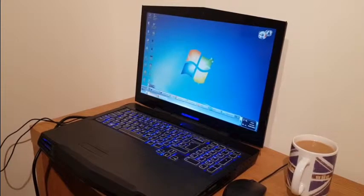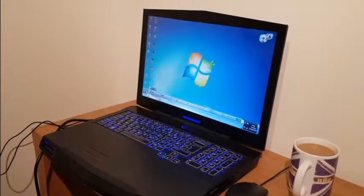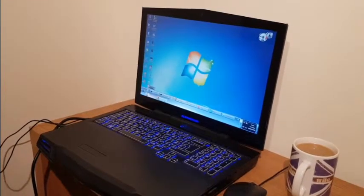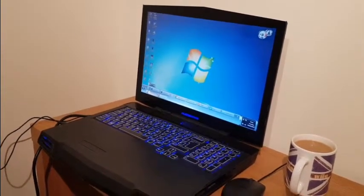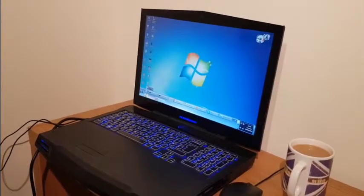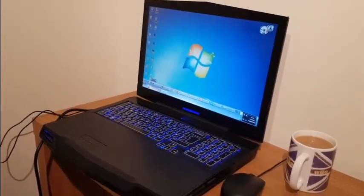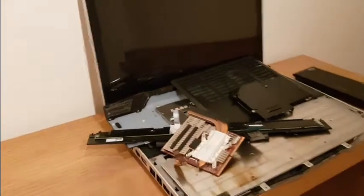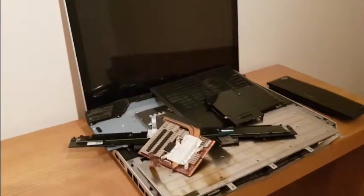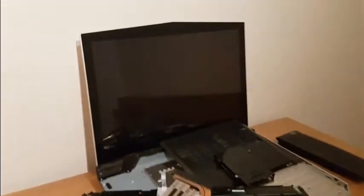At the moment when I am just plugging it in, it's not switching on — it's actually not even lighting the light up. So I want to check the motherboard in it. I want to see if I put the motherboard from that laptop into this laptop over here, whether it will start working. So here's my cannibalized laptop — the cannibalized Alienware M17 XR2.